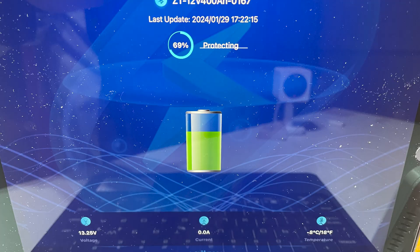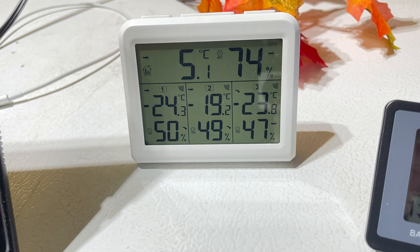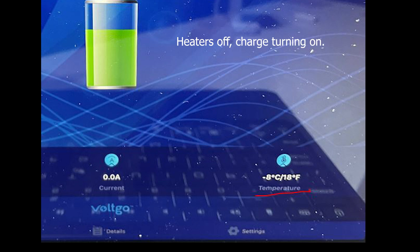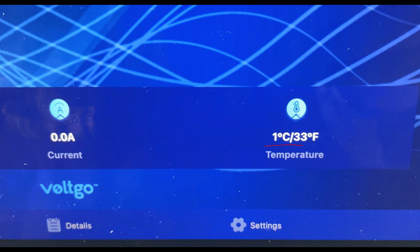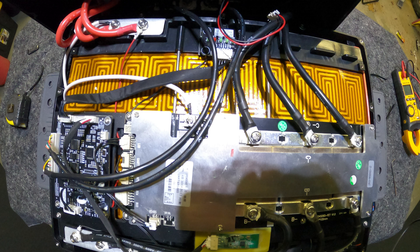Important note: when the battery is really cold — below negative 1°C — you're not going to get it to charge. As soon as you put the charge on it, you'll see the cell temperatures start to increase, and until you hit 1°C nothing happens. The app doesn't tell you this, but after a little digging and repeating this several times, we found that once the battery cell gets up to 1°C, things start to happen — the charger kicks on and it goes from protect mode to charge mode.